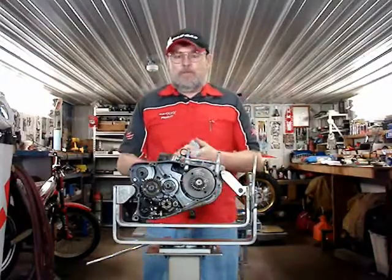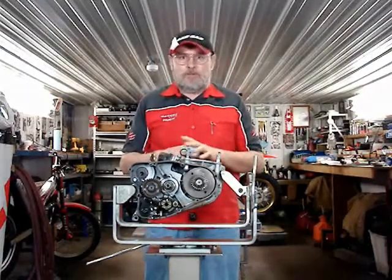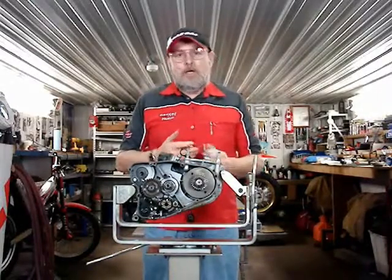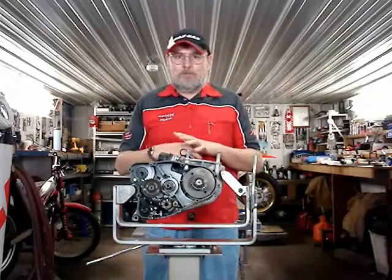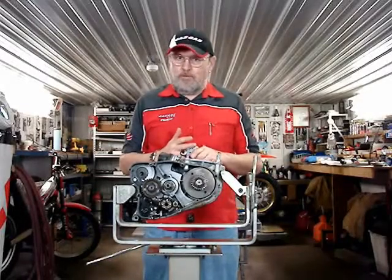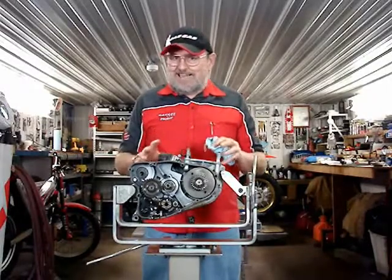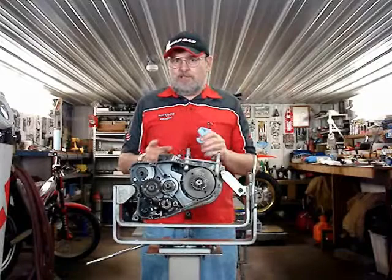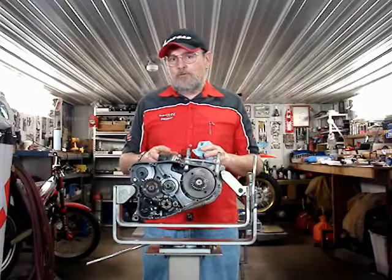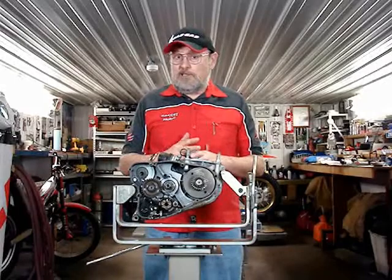To summarize, we don't recommend that you use an aftermarket clutch. We recommend that you replace all the fibers and metals as a complete assembly. If you're going to replace a clutch, do it right. We do not recommend synthetic oil in the transmission for any reason. Only 5W30 standard motor oil, Castrol, Pennzoil. This, again, I want to remind you, is not the Pro engine. This would be the edition models up through 2003, the Pamperas, and all of the Trials models previous to 2002. This goes back into the 1980s.